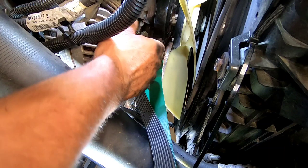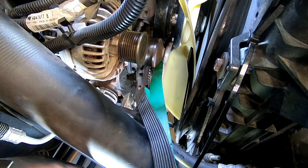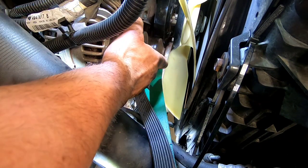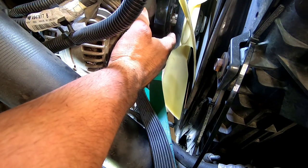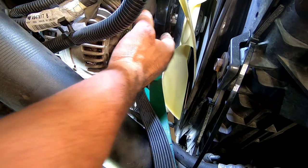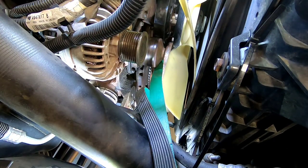What you've got to do here — because I know y'all couldn't see, but that's the only place I can mount this camera — you're going to have to slide your hand in there. You're going to have to push this belt in between the crank and the fan pulley. Just push this way, and then pull a little bit. Push, pull, until you work that belt in between — it's the tightest fit you've ever seen in your life.